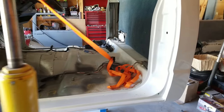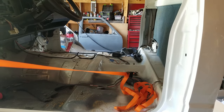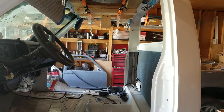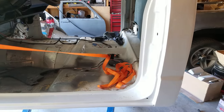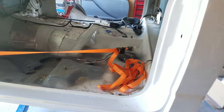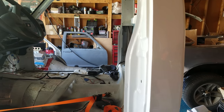The other issue I have is the weight and how the hooks are — this hole. Now you can see this is straight. It goes straight and the cab is parallel to you, horizontal or whatever you want to call it. So all I did was I took another ratchet strap and ran it to one of the seat belt bolts there, and ran it to the hoist, tightened it up a little bit so it would bring this cab back towards me so it's flush.